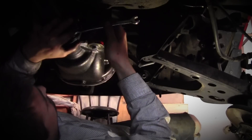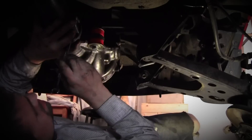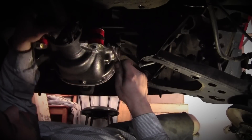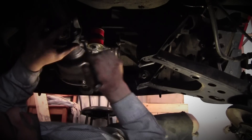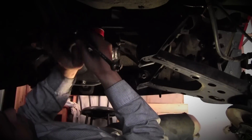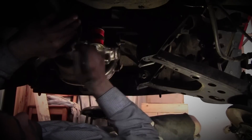The good news is the driveshaft went in after a little bit of playing around. Notes for next time: make sure the transmission is in neutral so that you can try to hold the drive shaft. I also have to lower the differential a little bit — I still haven't pushed it back up yet. We'll do that once the battery is in.